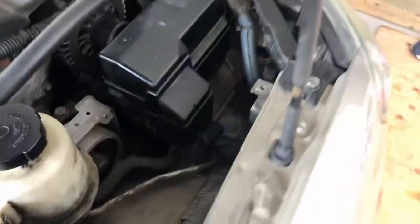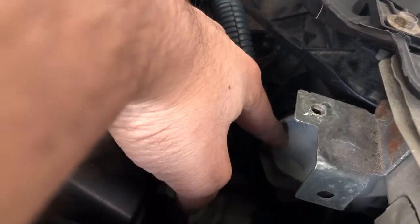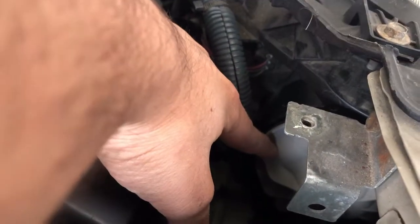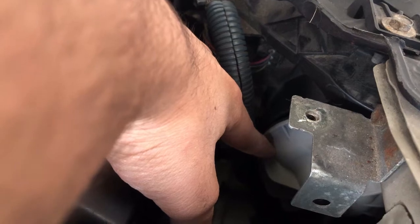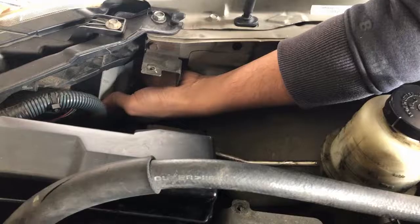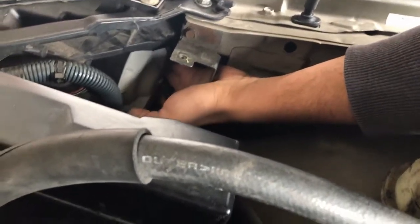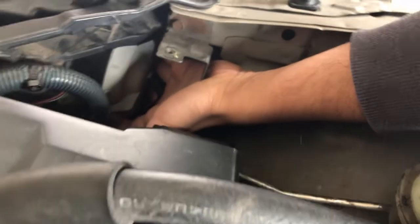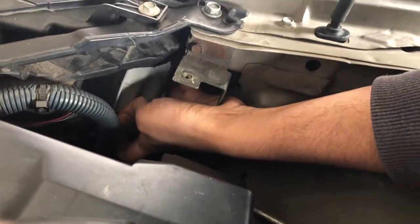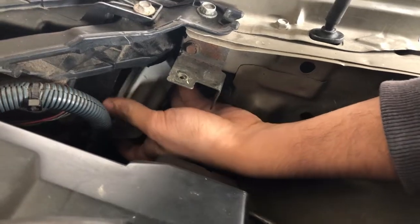You can see the white compartment here — that is the headlight housing cover. We need to remove it by turning it anti-clockwise and it will come out. After removing it, we will be able to access and eject the bulb. Now I have my hand in there — you can see the grooves. Press your fingers in and rotate it and it will pull out.